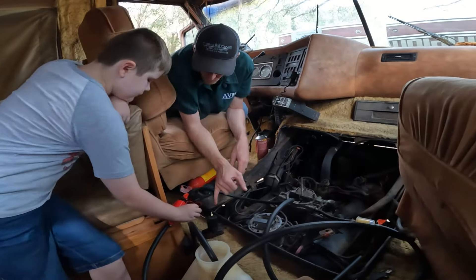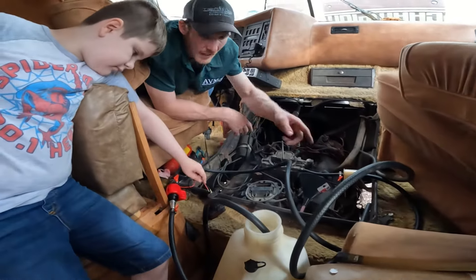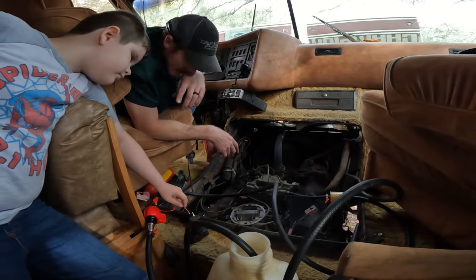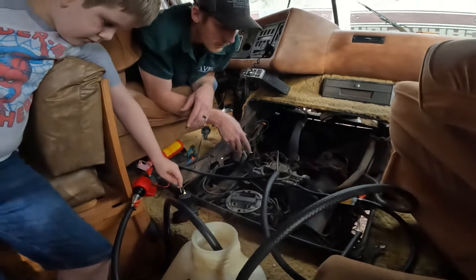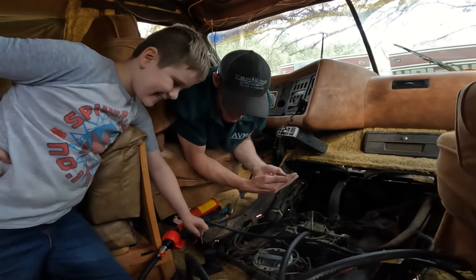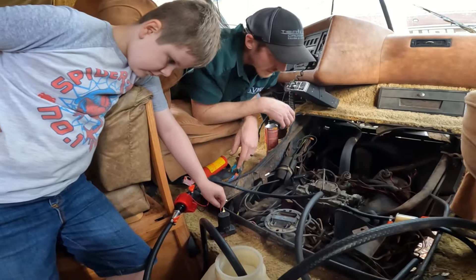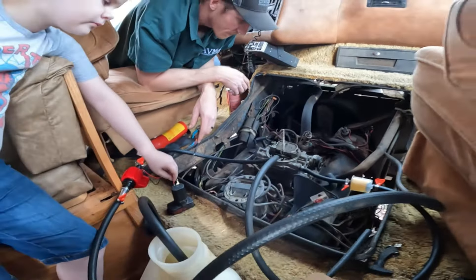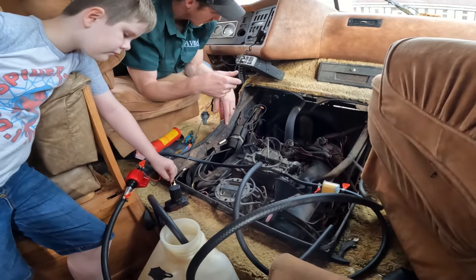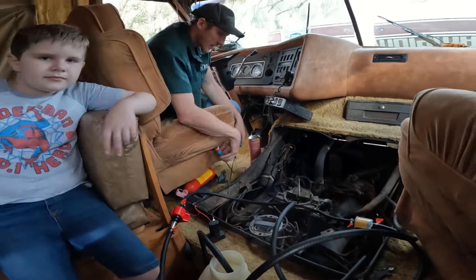Alright, whenever I tell you, put it right here. I have my own fuel system wired up — an electronic fuel pump with the line primed, because these pumps don't like to pull, they like to push. I have two inline filters going into the carburetor. We'll see if the bowl floats are stuck or doing their thing. Negative goes here — go ahead, put it in positive, hold it there. Let's see if we get fuel. I can hear it filling. Looks like we're holding — let's fire her up.